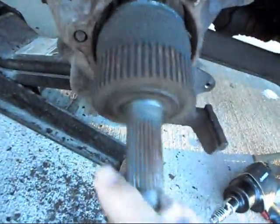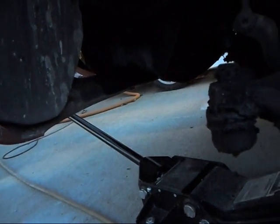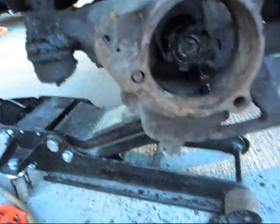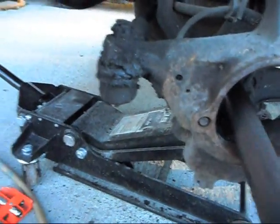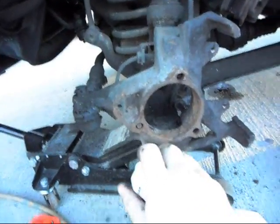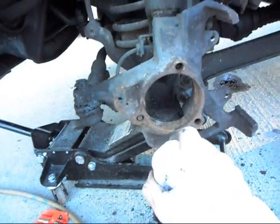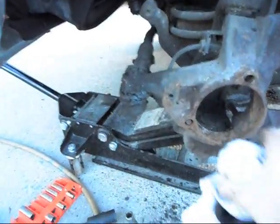Once that's done, you can see how this is supposed to be attached. You should be able to just grab it and pull it out of there. You just grab and pull — and there it is. The hardest part of this by far came from non-maintenance and being rusted. Use heat, use penetrating oil, don't get frustrated, take a break if you have to. So that's how you do it. Thanks for watching, hope you enjoy.